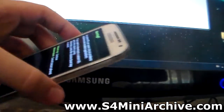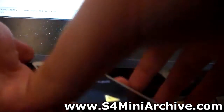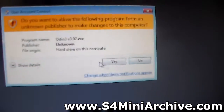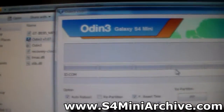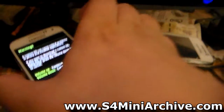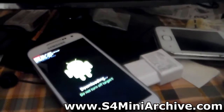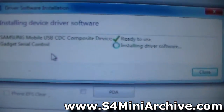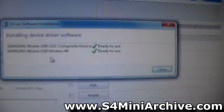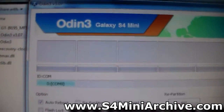After you do this, connect your USB cable to your Samsung Galaxy S4 Mini. Now leave it like that, and from the folder, open up the Odin program. Odin doesn't detect anything yet — on your Galaxy S4 Mini, press the volume up button. Windows 7 should begin installing the drivers. It says ready to use, everything is ready, and as you can see we have established the connection with the Galaxy S4 Mini and the computer — Odin manages to recognize it.